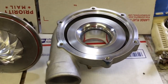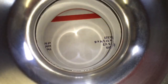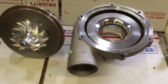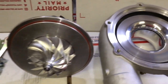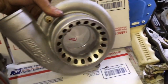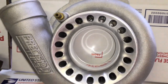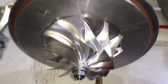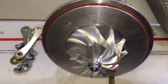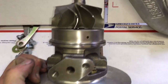To make the journal bearing version, I have to have a special 2mm Superback plate, which is kind of rare, so I haven't been able to build very many of these in journal bearing form. But I'm trying to have that plate remade so that I can build a lot more. That plate was commonly found on the 6176 and other versions of the turbo that Precision had that had a GT35R compressor wheel. This plate allows you to run ball bearing compressor wheels with the TO4E compressor housing. Precision eventually switched over to the 5mm Superback Hype wheels and plates, which is the original plate that comes from Garrett turbos from the factory, so they kind of just discontinued the 2mm plates.